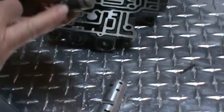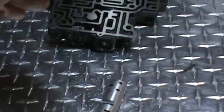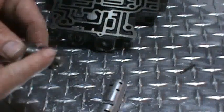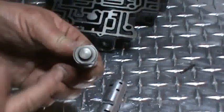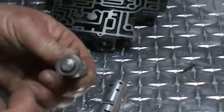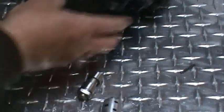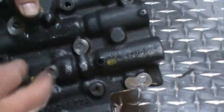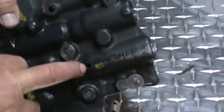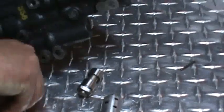You'll see this land here on the 1-2 shift valve — normally it would be circular. I've ground a half-flat on each side of the valve. We're going to grind a flat on each side and deburr everything, because this valve must move freely in its bore. There's also an exhaust valve here which I've drilled out to 7/32 of an inch. Deburr that and open it up just a little more with the drill bit, but not too much — be careful.